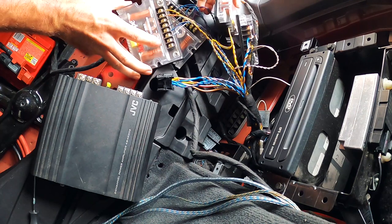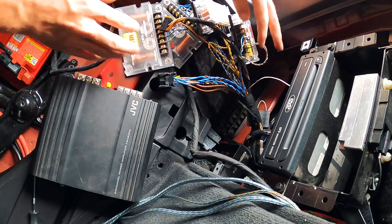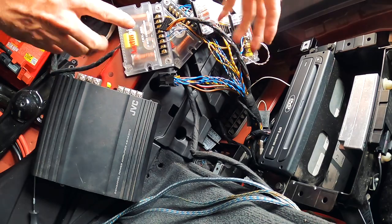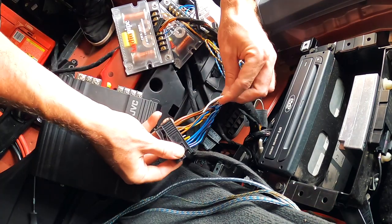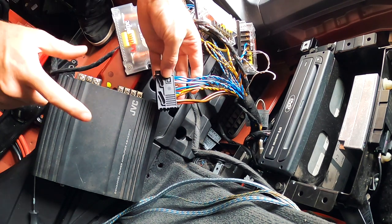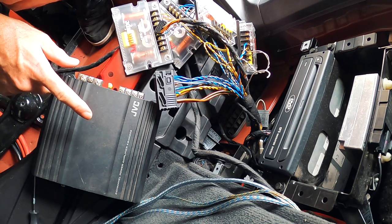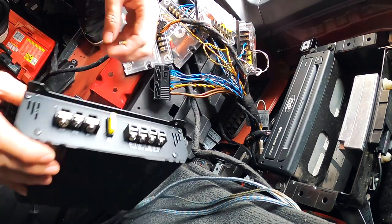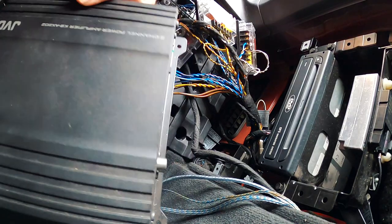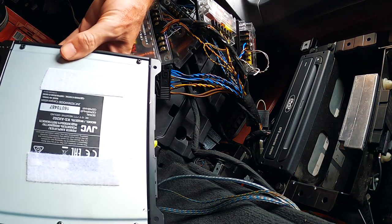All of the in-cabin speakers are done — six channels in the front and four channels in the back all wired in. You've got to make sure you have the positive and negative the right way around. If you get any of the polarities incorrect it will basically make the whole system sound funky. This white wire is the remote turn-on for both amplifiers. I've decided for today to just wire in this little cheap amp into the factory subs. The factory subs are dual voice coils and 8 ohm voice coils. This amp was on clearance, maybe 20 bucks. It's not very powerful — it's a 200 watt amp apparently, but I get the feeling it'll never actually make that power.